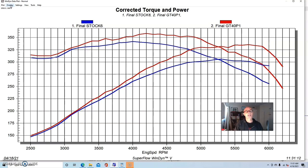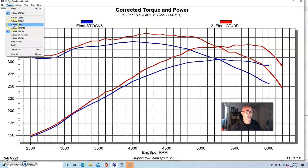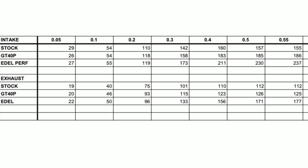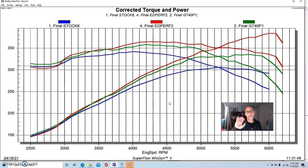There are a ton of aftermarket aluminum heads out there. Let's look at a set of Edelbrock Performer heads — kind of a middle-of-the-road head. There are lower-buck alternatives; on Summit they run about $500-550 each, putting them in the $1,000-1,100 range — obviously a lot more than the GT40P heads. I'll put the flow numbers up on screen. The Edelbrock head flows quite a bit more air, and similar to the GT40P vs. stock comparison, most gains come at higher lift ranges, producing more power past 5,000 RPM with a good torque gain from 3,700 RPM on out.